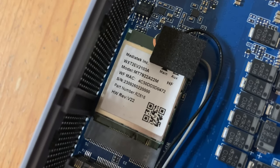It's kind of sad to see that the BIOS here is fairly lackluster — we would have liked a few more settings, such as fan profiles and memory clocks. But we can increase the graphics frame buffer to 4 or 6GB, which can help performance in AAA games. Some titles such as Valorant require Secure Boot, which is accessible here. We can also change the TDP to Quiet at 45W, Balance at 54W, or Performance at 65W. There's an auto-power setting, handy if you wanted to use this in an arcade cabinet, and we can boot to the NVMe stick we just installed.